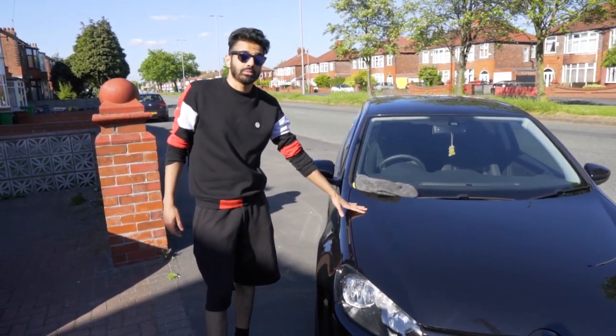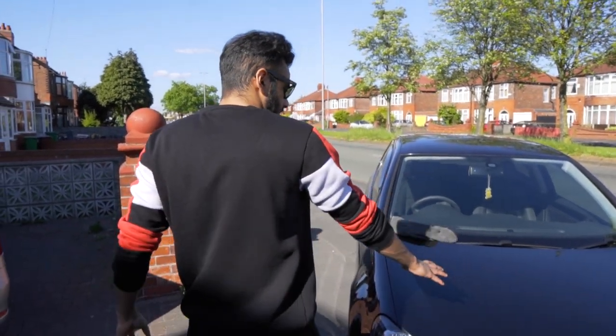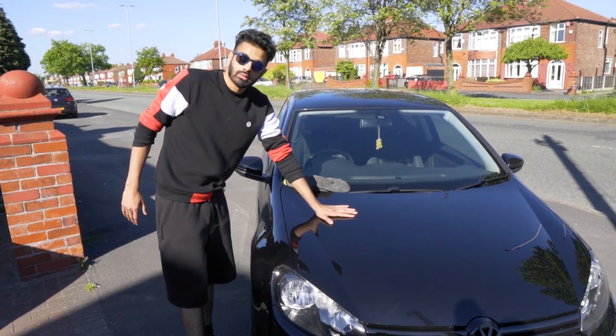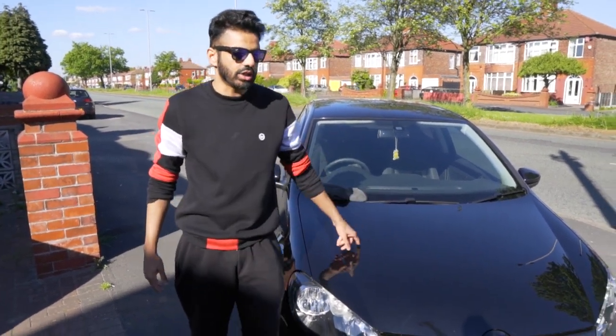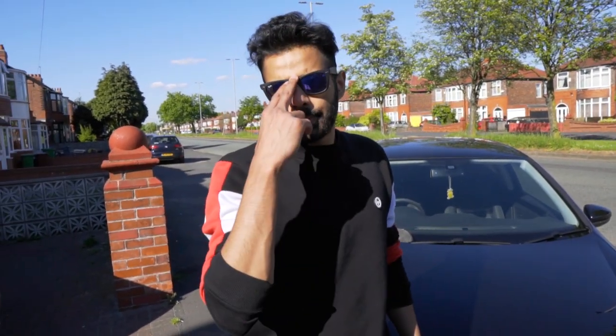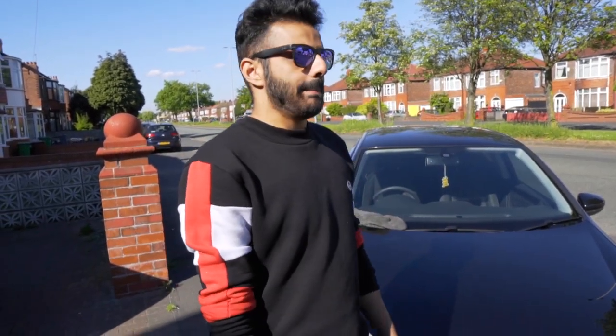So I'm tired as hell. So that is pretty much how to machine polish. Yes, cutting. Oh yeah, I'm doing wax. So now I need to put on wax, and that's pretty much it. Because right now it's been polished, so we need something to protect it. I think you could leave it, or you could use some quick detailer because it'll have something in there. But I'll put some wax on and then we'll give it a bit of a water test.